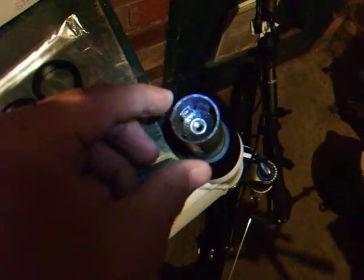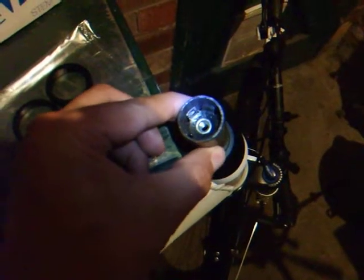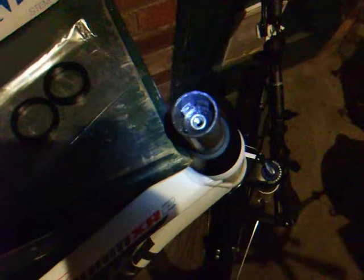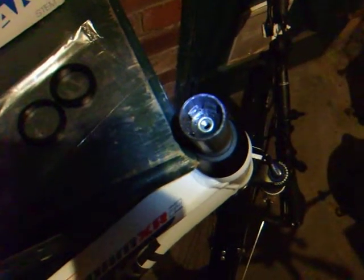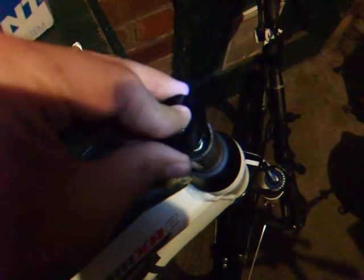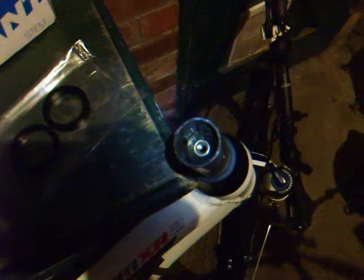You can see this compression nut inside — it looks a bit like a star washer and it's fixed into the steerer tube. Now when you have the stem on and then you use this cap with the allen key on the top, its job is to fix into there and then draw up the steerer tube to take out the play in the bearings.